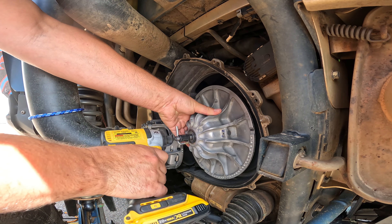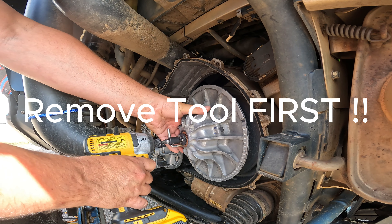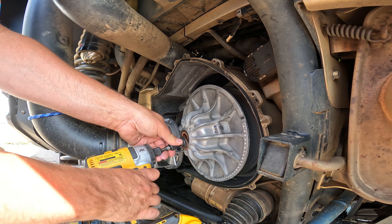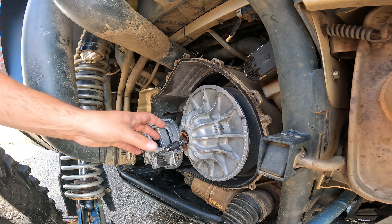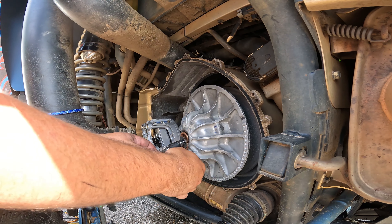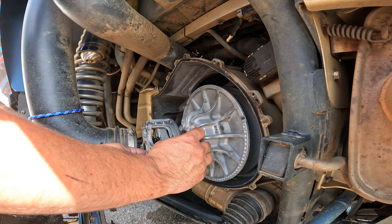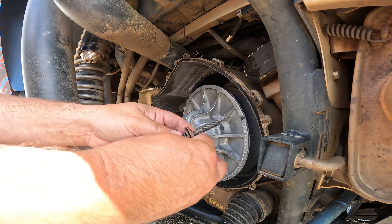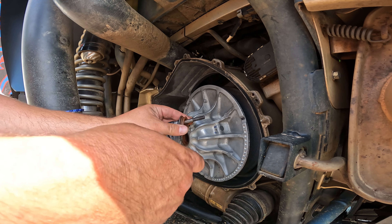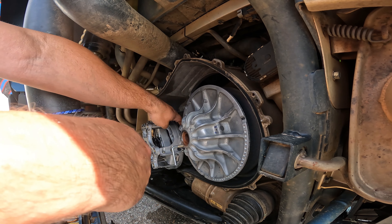10 mil. I felt that spring — probably because this was on there. I guess you should undo that bolt before you pull it off because it's putting tension on there. And then you gotta watch all your shims here, make sure you get them all and don't lose any. These are the shims — in case you're finding it's tough to shift, or this is spinning while in park or neutral, these are the shims you ought to put in. That adjusts this in and out so the belt rides right in the middle.